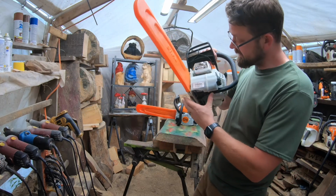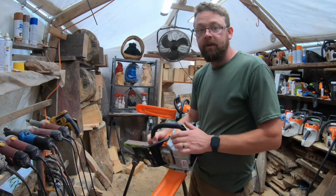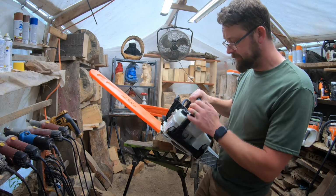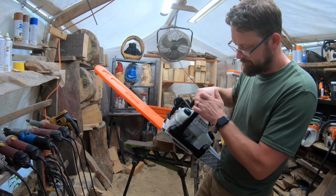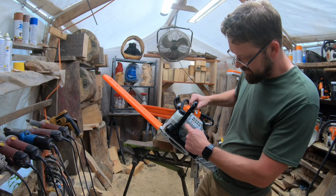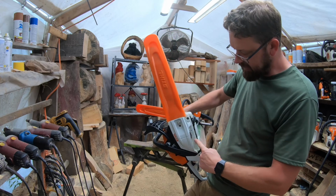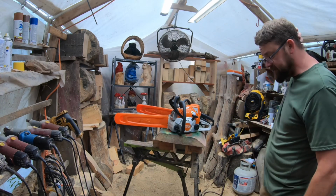So it doesn't look to me like I can just slide my fuel tank out. On the new one, the motor housing and the gas tank are all one piece. The dogs are cast in the same material as the oil tank, which then comes across to where the recoil hooks, which is then cast on the exact same piece as the fuel tank. And then we go underneath, and the motor is also bolted through there. Then we come around to this side, same thing over here. The sprocket's in here and all this is all one piece. Gas tank, oil tank, all that looks to be one piece to me. So that makes me a little nervous.